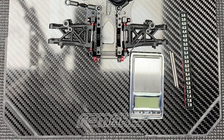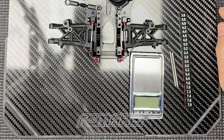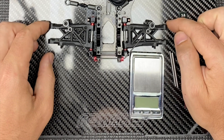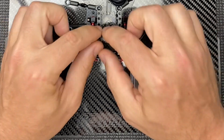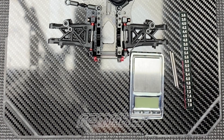What we're going to do is get the most accurate reading from your sway bar. To start with, make sure the sway bars themselves are flat — put the sway bar on the setup board and check that it sits flat. Get that as flat as possible, then install it into your car. Also make sure the arms and suspension pins aren't bent, the arms are moving freely, and take off any top arms. We're only dealing with bottom arms and sway bar points.